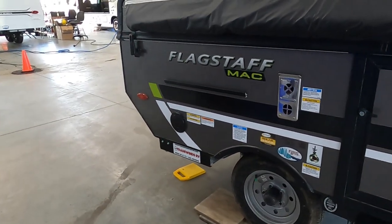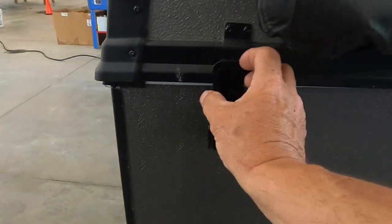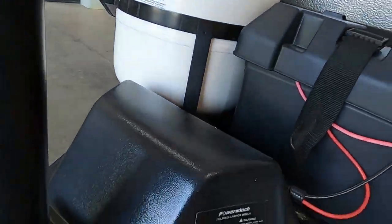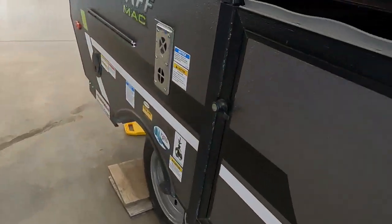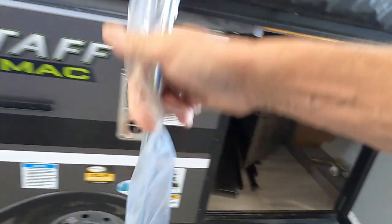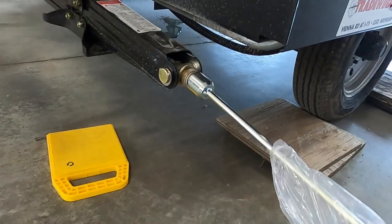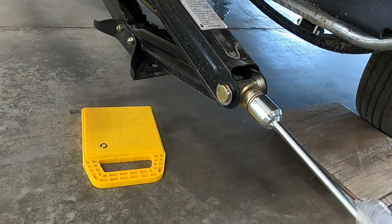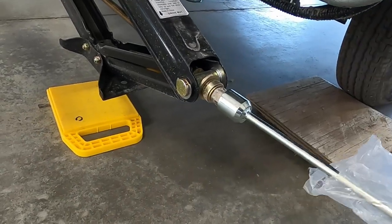You'll have a hand crank. When you arrive, walk around the unit and unhook all four of the clasps, then hit up on that — that'll raise it with your battery just enough to get in your door. Inside you'll find your stabilizing jack handle. On the rear you have three-quarter inch stabilizing jack scissors. I recommend stabilizing jack pads — they protect the feet of your jacks from dirt, debris, and hot blacktop in summer, and better distribute the weight. You can get a pair from our store with your 10% off coupon.